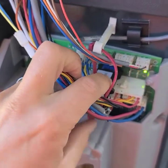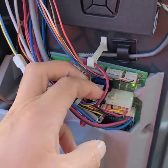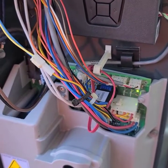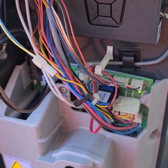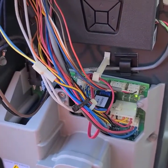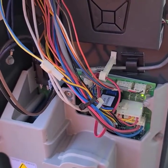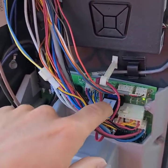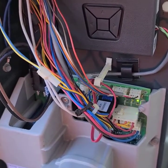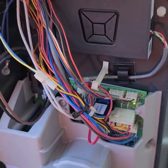One thing to add: this little plug on the drive right here needs to be plugged into the new board — they put a little red zip tie on it. You definitely want to reuse the one that was on the old board, because that's what has all the programming to tell the drive what it is — the model and all that. All the programming is in that plug, so make sure you reuse it unless it's compromised, in which case your parts source would need to give you the proper one. Otherwise, almost always reuse the same plug on your new drive.